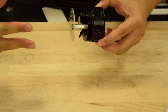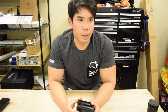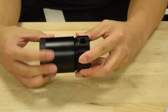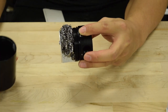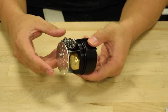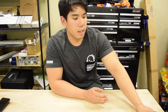To me, I find that a little bit worrying. I wouldn't want the filter media to come into contact with dirty air so late in the cycle through the can. So I opted to modify this design and create a true baffle to funnel the contaminated air through a filter media that I added — just steel wool. After it passes through my added filter media, it then wraps around and reaches the original media as a failsafe, just to ensure that the intake gets the cleanest air possible.